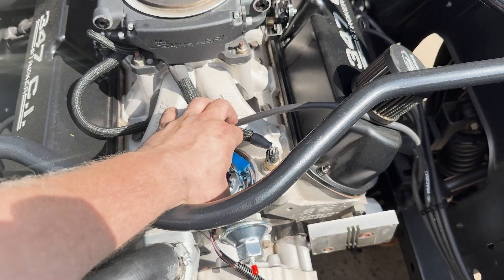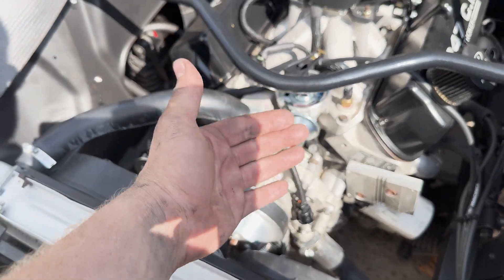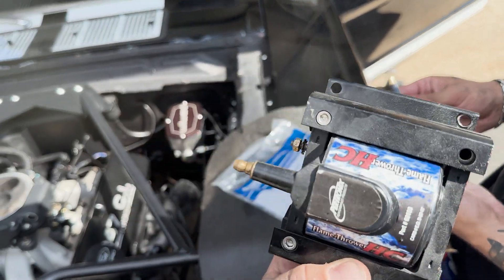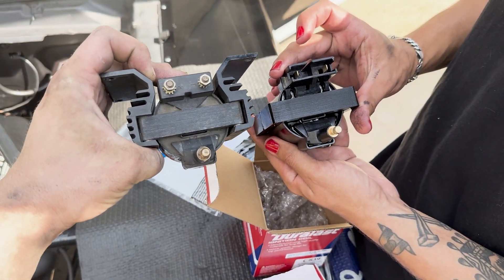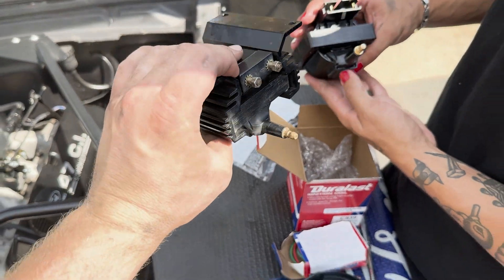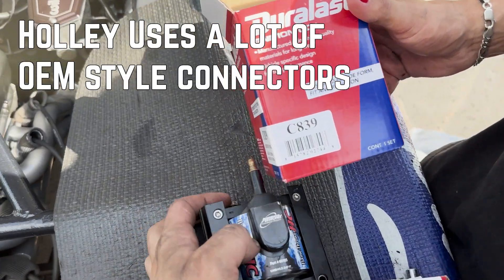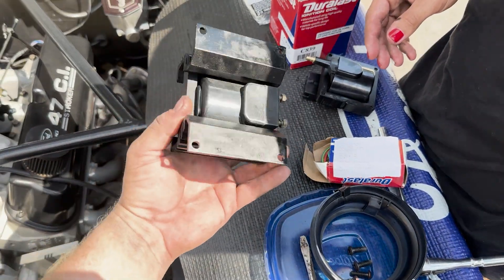I'm aligning the magnetic pickup — that gray piece in the white oval — with the reluctor tooth as best I can, and locking the distributor down. The vacuum advance isn't the prettiest thing but it's actually locating the magnetic pickup; the pickup would move without the vacuum advance can. We may in the future make a block-off plate, but for now we're leaving it in place. We're doing the super budget approach to get the car back on the road with timing control. The Pertronix flamethrower coil is basically an upgraded version of a stock GM HEI small-cap coil or Ford TFI coil. We're not completely sure if it's causing a stumble off idle, so we're going to replace it with a new Ford TFI unit. This TFI unit uses the same connector that Holley uses on their Hyper Coil and should also fit in a Hyper Spark heat sink.